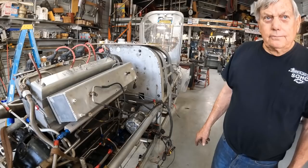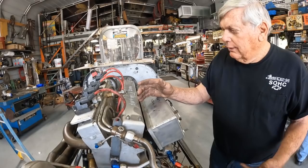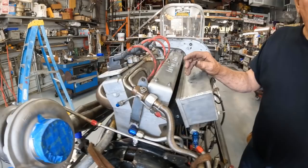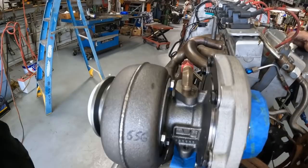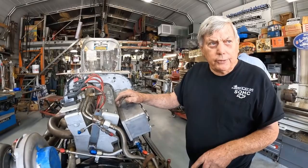The cylinder head — you guys built that? Yeah. It's a three-valve: one exhaust, two intakes, twin cams. It's like all the heads we've made. And this is the turbo — brand new turbo. All the exhaust work is on that side. We'll try and run this in May and June at El Mirage, then we'll put the 12 in the car and take it to Bonneville in August.